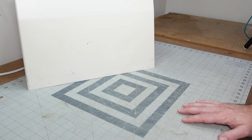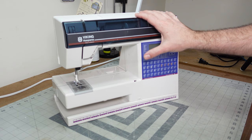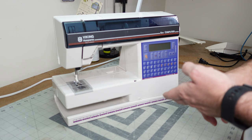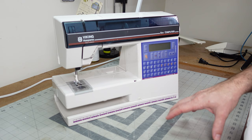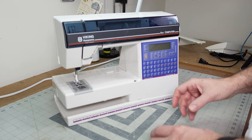Don't forget about all the lint in there. I've seen lint in a machine that's been matted so much it basically looks like a piece of felt when I pull it out — hard felt. When you get a sewing machine into your shop, this may be the first time you've opened that type of machine. There are so many different types; it seems like every one I work on is different. That's why in this series we're going through the basics so you can apply them to all different types of sewing machines.